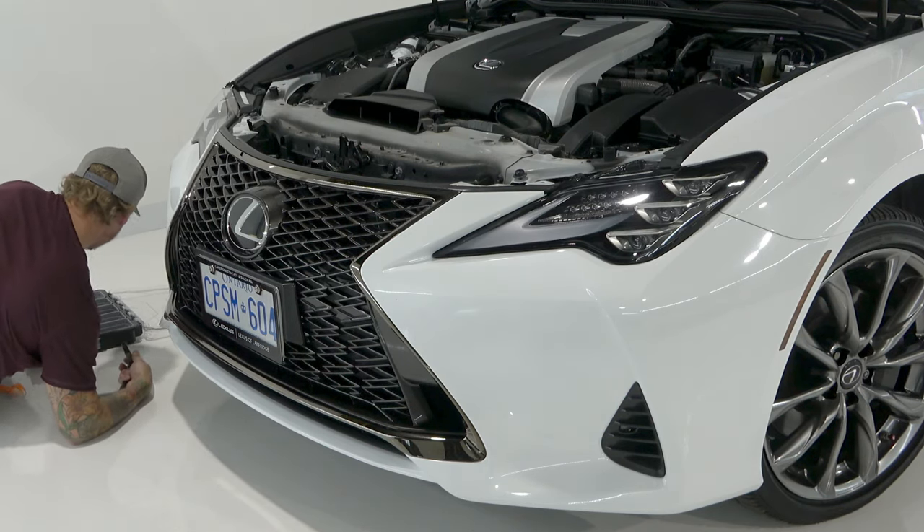Let's bring the bumper stand over. I've got my trusty hook tool - this does help to have two people. We're going to double-check - make sure there's no more sensors. I see one but it looks like it's actually mounted to the front rebar, so I'm not worried about that one - that's probably for the air temperature. Let's unclip this side. I'm going to lean against the bumper slightly just so it doesn't slide right off. We're going to take this off real slowly and make sure there's nothing else connected. There shouldn't be anything connected anymore - all of it's off. Excellent! There is your front bumper removal. I'm going to put that on our bumper stand. You can rest it on a chair or a table or whatever you want. This bumper has very low mileage - there's barely any scratches on the bottom.